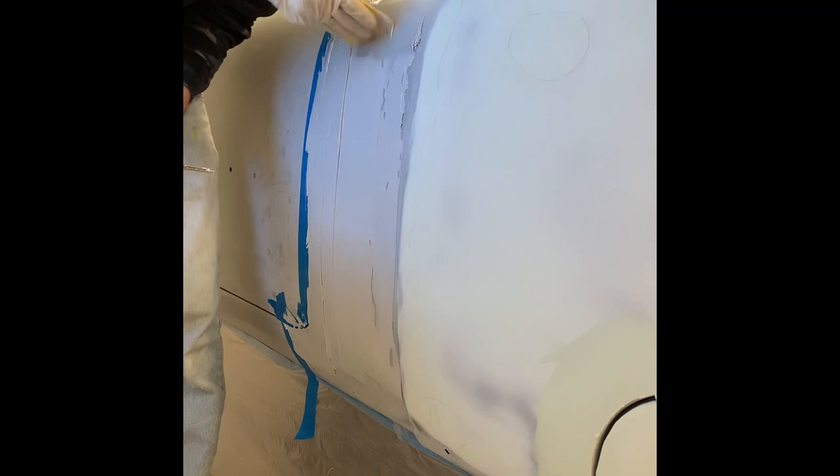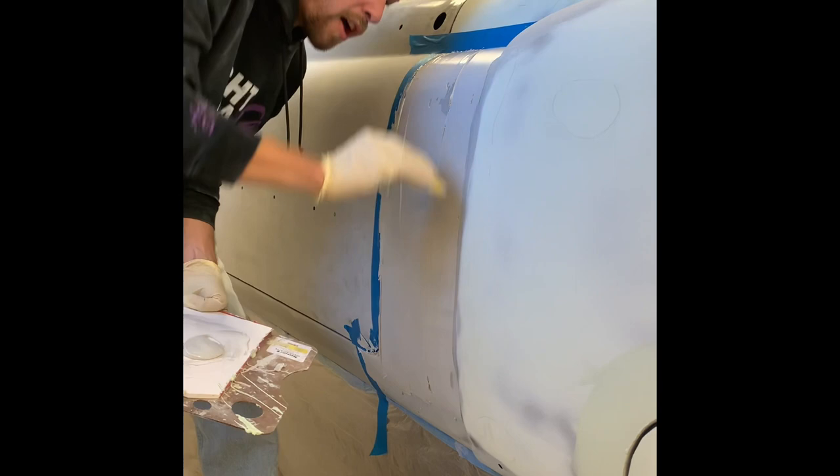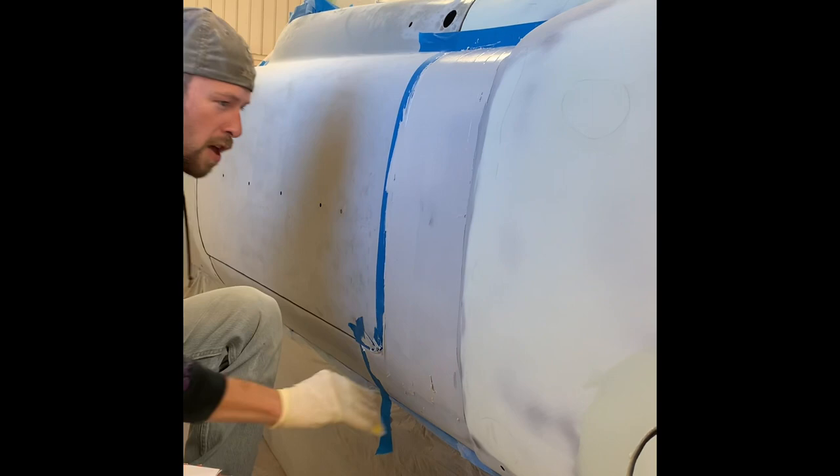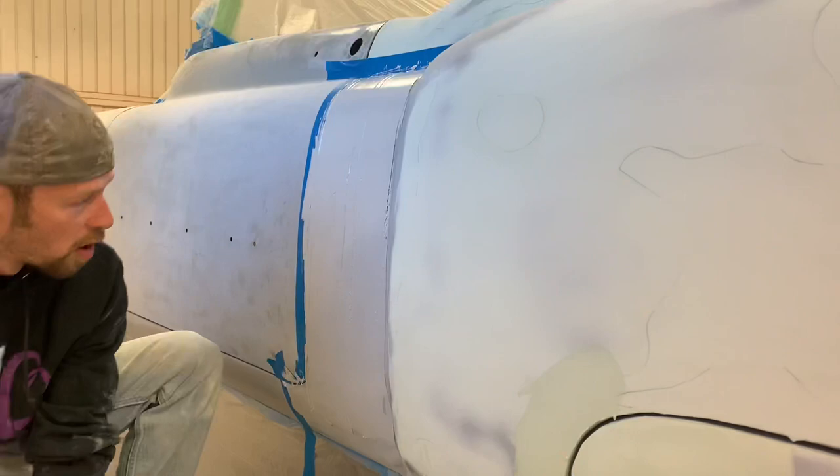What I like to do is start with a nice tight coat. I'll use a small spreader and push it down into those sand scratches. Typically I'm using VP 2050, which is on this car. A lot of times I'll buzz over it with 80 or 120 on a DA and rough it up, then come back with 80 or 120 by hand and hit the low spots — prepping everything really well for filler so that we have mechanical adhesion into the scratches.